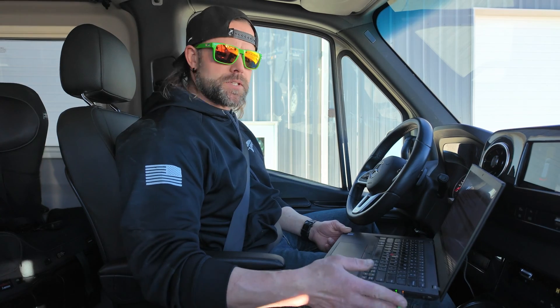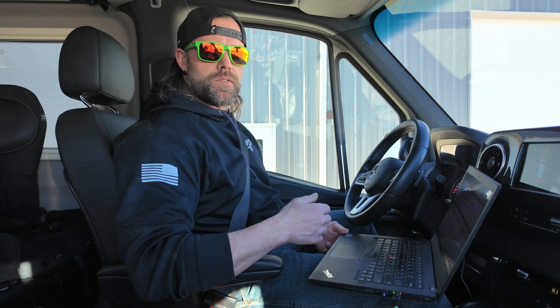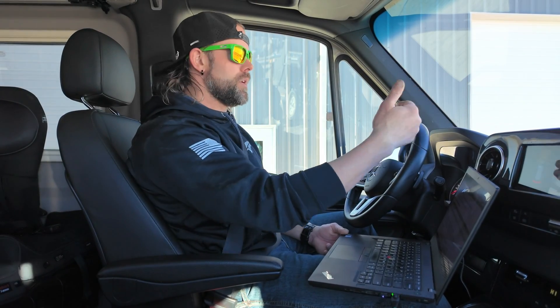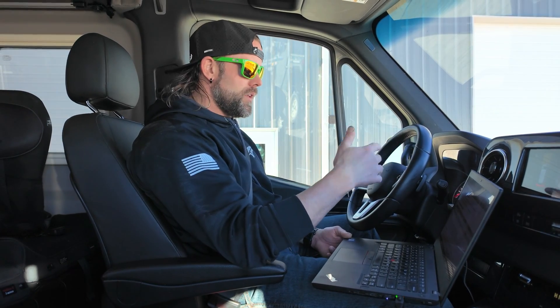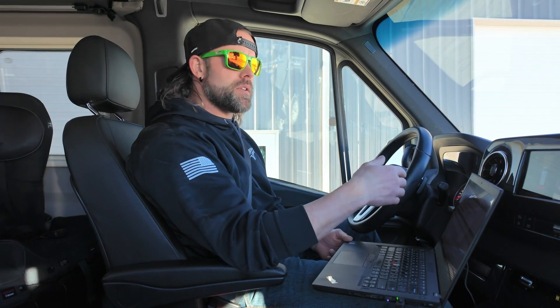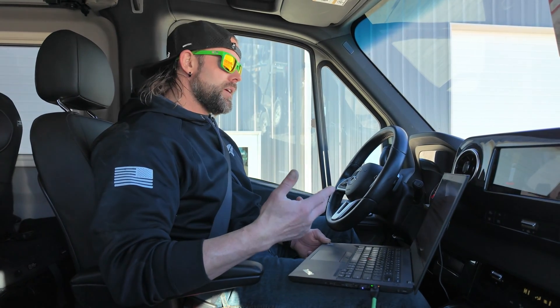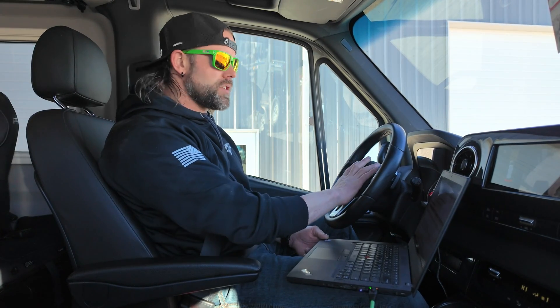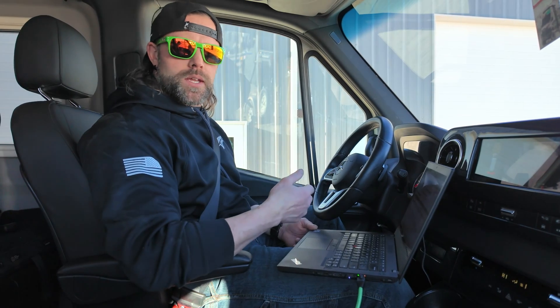There are times where you can simply adjust the sensor and it will calibrate on its own, but most of the time you're going to have to get it recalibrated, especially if it's persistent. One thing to keep in mind: after a certain amount of time, if you're driving at night with no traffic in front of you, the sensor won't have a vehicle to read off of and the system will not allow you to use cruise control. On the newer 2023 and up vans it's like an hour to an hour and a half; on some older vans it seems a little longer. So if you've been driving for three hours in the middle of nowhere with no traffic, that's probably why the warning is appearing. Most of the time, stop for the night, start up the next morning, drive in traffic again, and it'll start working.